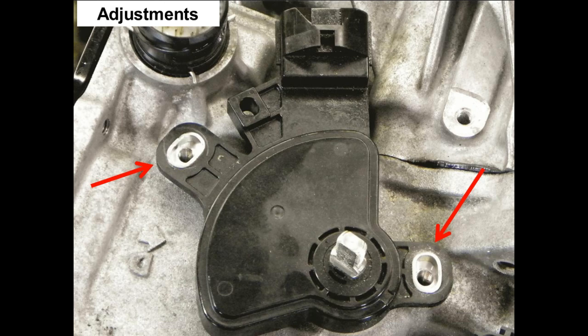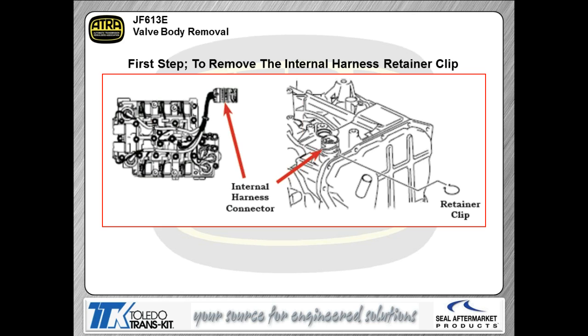So again, different approach. The one other thing that I do really like about this Prindle switch design is that they make the switch adjustable. In America, one of the things we run into quite often is the EPA puts a lot of pressure on manufacturers to make things non-adjustable. Because the theory is if they're adjustable, that also means they're misadjustable. So the bottom line is they would like to have everything non-adjustable. Well, in this instance, as you can see, the Prindle switch is adjustable because this thing is sold not only in the continental U.S., but obviously across into different countries and so forth. So bottom line is kind of a nice little feature that we're actually not used to seeing.